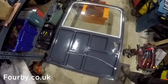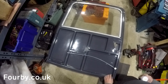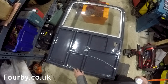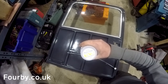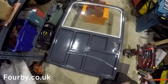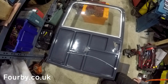One of the things I want to do with this door is protect this bottom section as best I can from rusting out. Nearly every single Defender door ever made has wanted to rust out along these bottom ribs. So I'm using this, which is the Zero Prep from Buzzweld - this is an injectable cavity wax. What I'm going to do is drill a few access holes around the place and inject this inside the ribs.